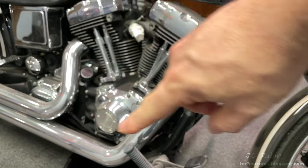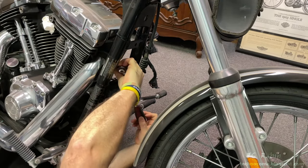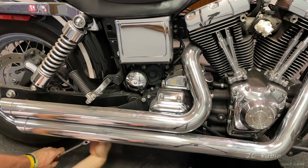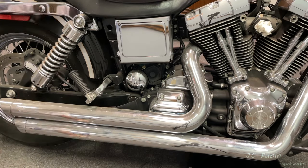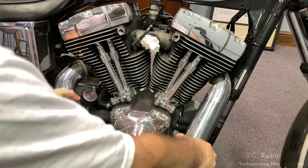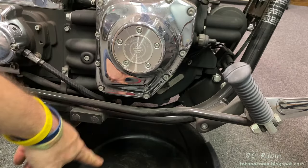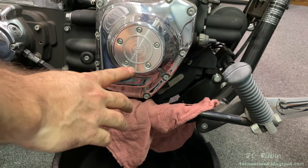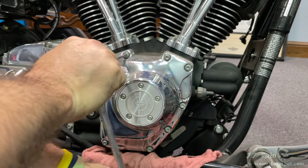We're going to have to remove the exhaust system to do this job. A half-inch will remove the nuts from the studs — let it soak with penetrating oil if necessary. This is a one-plus-one exhaust so both pipes need to be removed together; on some bikes you only need to remove the front exhaust. When removing an exhaust like this, take your time — the goal is not to damage anything. Some oil may come out, so have a catch pan below and a rag over the brake linkage. With the 3/16 hex, loosen these bolts in a cross pattern.